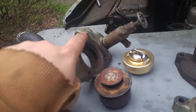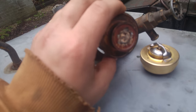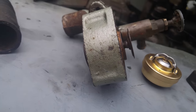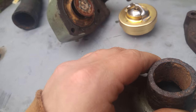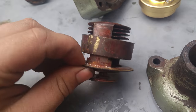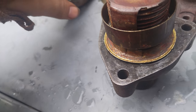Now, in the one that was in here — and this one, as you can see, is stuck open — the thermostat goes down in there, kind of sticks out the bottom a little bit, and then the upper housing pushes onto there. If you see this rolled, kind of crimped edge, the interface on this is actually small enough that it pushes on that crimp and makes a seal there.